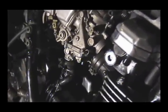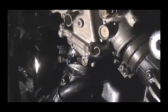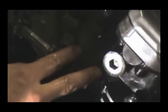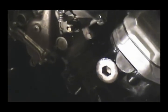And I'm just going over here to put this loose boot back up here temporarily. Like I said, cylinders 2 and 4, the boots don't go on yet. Get it set up for cylinders 1 and 3, which is the rear cylinders. Leave your clamps loose on your collars. Cylinders 1 and 3 sleeves are pushed all the way on. Cylinders 2 and 4 are not.